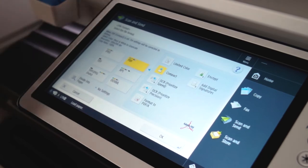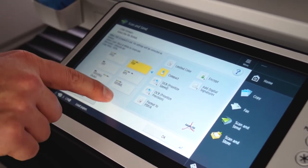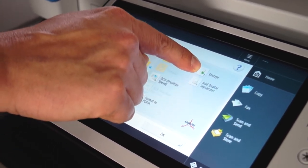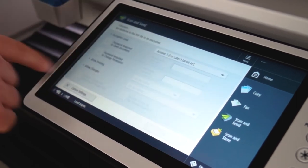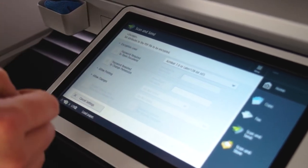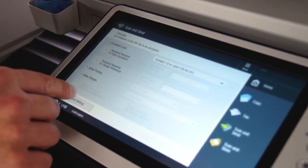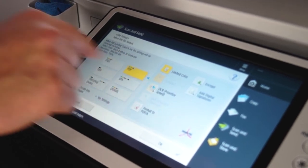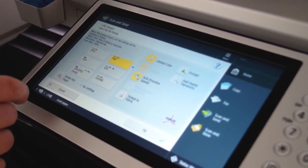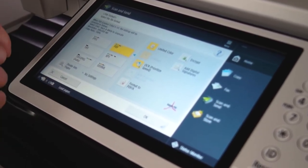Here's where you can change what kind of file will be coming through — you can do PDF, JPEG, or TIFF. One thing that's very cool about Canon is that they do encrypted scanning as standard. If you hit the encrypted button, it will ask you to put in a password that you'll need to enter when the scan comes in to view it, and anyone you forward it to will need that password as well. You can also do OCR, pick your language, and it will OCR your PDF. You can also scan to a PDF/A format, which a lot of legal departments need.